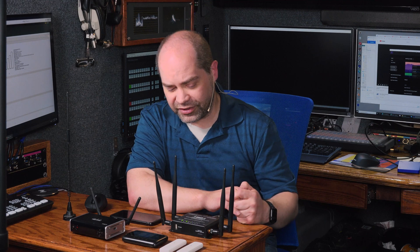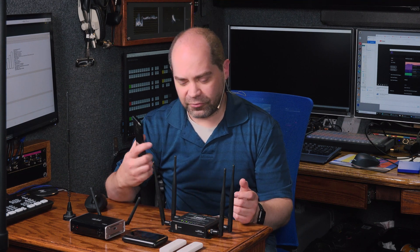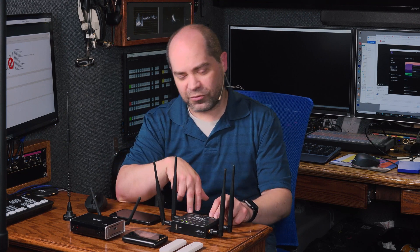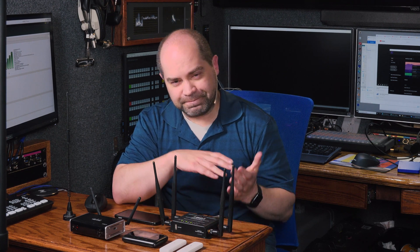In terms of reliability, it's always better to go wired than wireless. In addition, this particular device supports carrier aggregation, which gives you more bandwidth by combining multiple radio bands. By default, cell phones only use one radio band, but this allows you to combine bands — in my area, the carrier uses bands two, four, and twelve — so you're able to get a lot more bandwidth than you possibly can from a cell phone, hotspot, or USB modem. You also get faster speeds — just a better deal altogether.